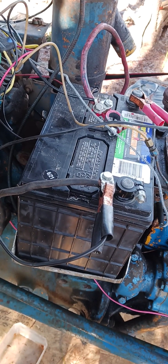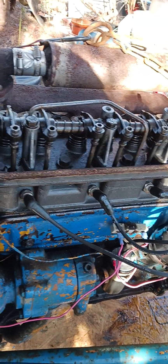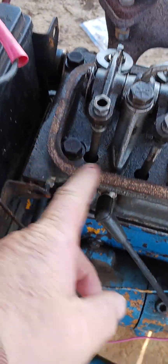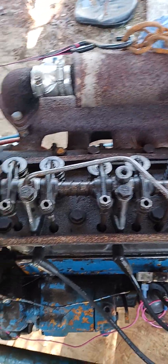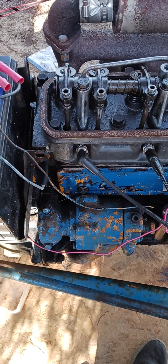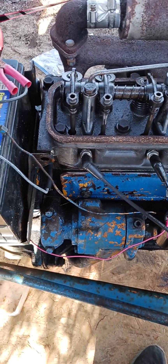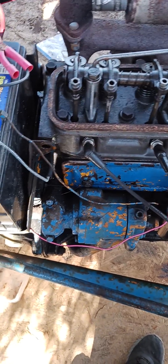I just want to get it running. I'm going to have to re-torque those bolts — one, two, three, four, five — that are inside the head, and the rest are on the outside. I'm just doing everything the way the book said: re-torque them after the engine runs. She does seem to have a little bit more, but it could just be the weak battery.